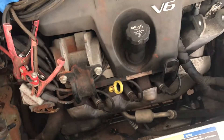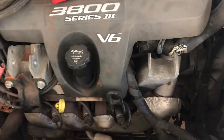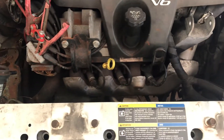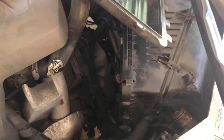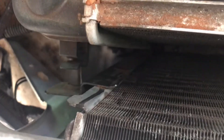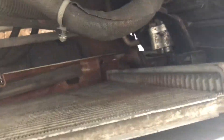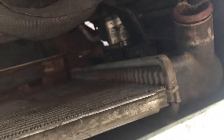You've got to take your radiator fan assembly off first. There are two motor mounts that come across here — one there and one here. So there's two motor mounts you've got to take off, you've got to take your battery out, and you have to take this air filter box out. The biggest thing is your condenser, which is right there — looks like another radiator, basically a radiator for your air conditioner. It clips in on the top on both sides, and you can't get it out far enough because of that air box, so you've got to take that air box off first.